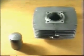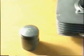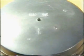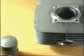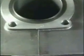Prior to mounting the piston cylinder assembly, both parts have to be examined to make sure of the correct standard, 0.05 mm clearance. The arrow on the piston crown faces to the outlet port, and the punched figures indicate the piston diameter in millimeters. In the demonstrated case, a cylinder of the +1 tolerance group has to be mounted. The marking +1 corresponds with a liner diameter of 69.01 mm. Tolerance group marking is indicated by punched figures on the cylinder top.